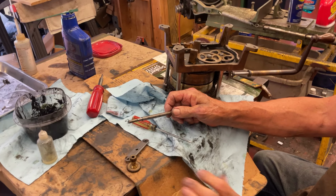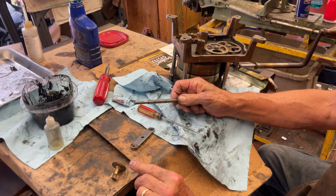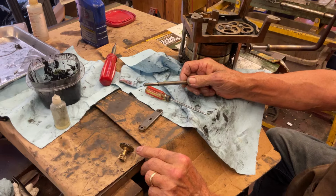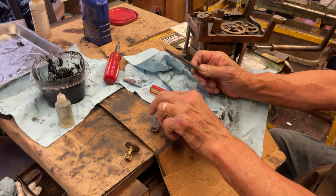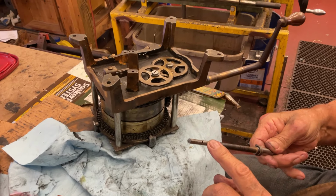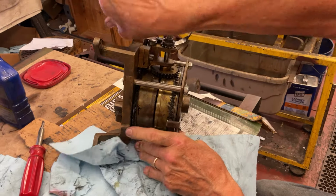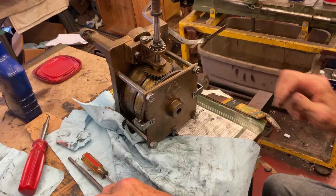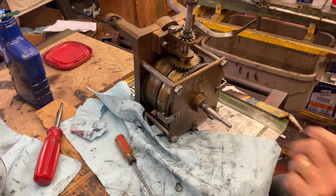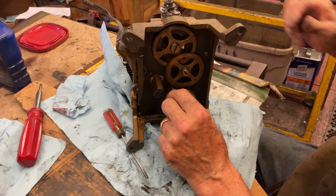and we have to put this gear on. This is the governor drive gear, and that's a plastic, or one of those fiber gears, and we're not going to grease that. We're going to put super lube on that. But what you have to do is put the spindle shaft through, liberally put STP through here. Spindle shaft through where? You're going to put the spindle shaft right through the top right here. And that's going to go all the way down to here.